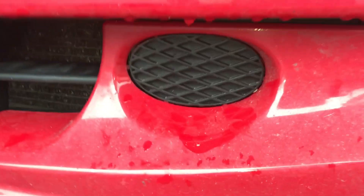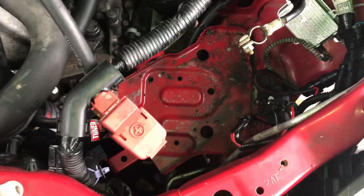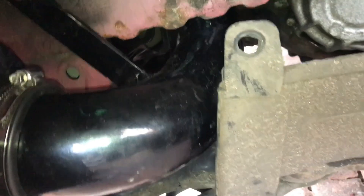To get the maximum air through to your wheel arch, you're going to want to come and remove this fog light blank. There are little red tabs all around it that you literally just cut with a blade. Then you can come and put basically everything back together — your battery terminals and your wheel arch liner. It does need to be cut out down there to make sure it goes around the surroundings and you can still get the bolts back in. Now we've got our wheel arch liner fully built back up, and we've got our little grooves cut out so it slots right through.